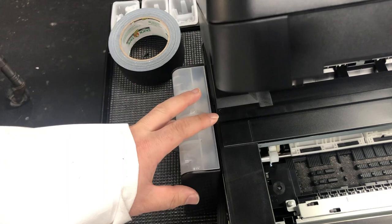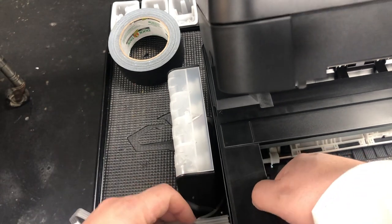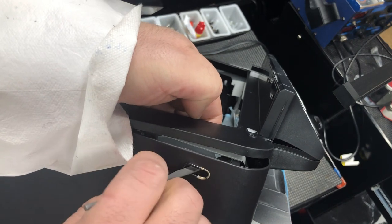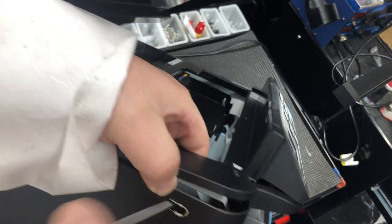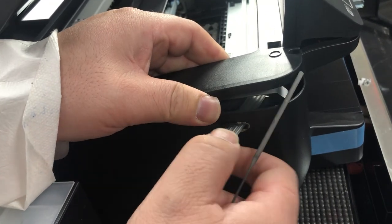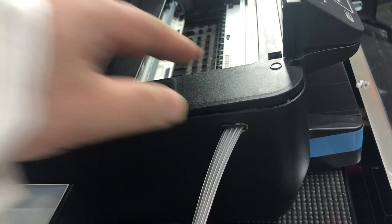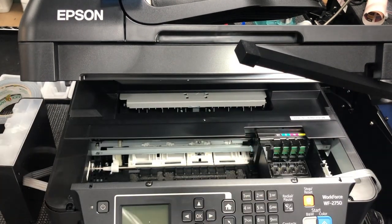Now it's time to bring out your tank. Our goal is to have the tube go through the hole we just burned and go inside the printer. It's not as easy as it seems. If you take a look, there's a metal plate inside, so your tube will go in here through a little opening. Lift the cover up and put the tubes in — you can see the opening right there. On the other side of my hand I have a poker; just poke the tube down to help it go through the opening. Once it's in, pull it and make sure when you pull it is smooth, so you know there's no kink.